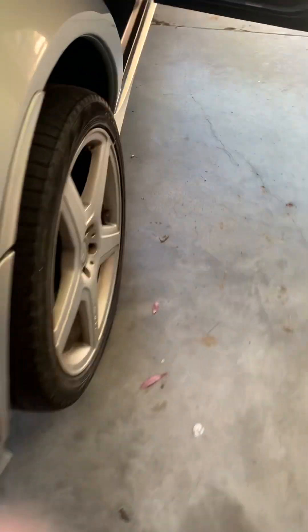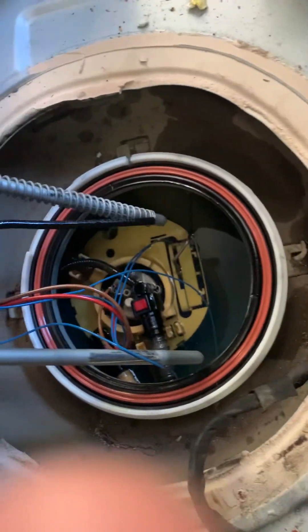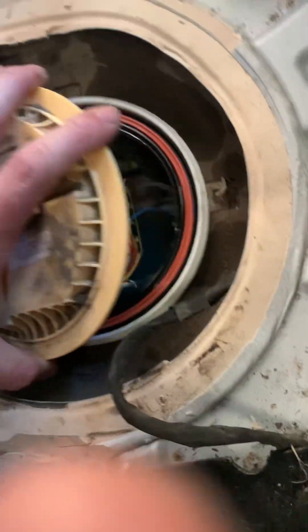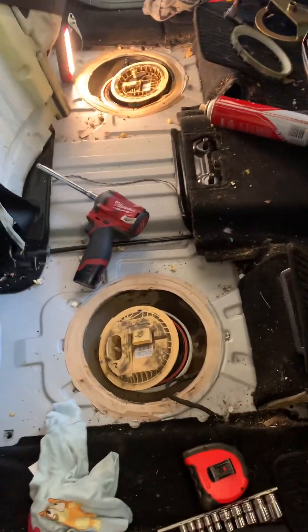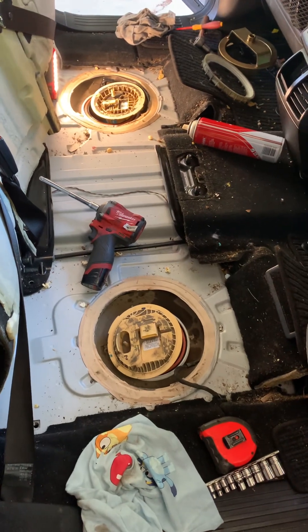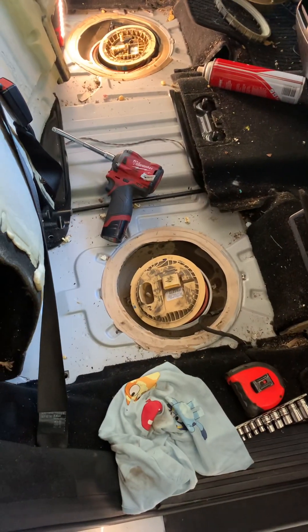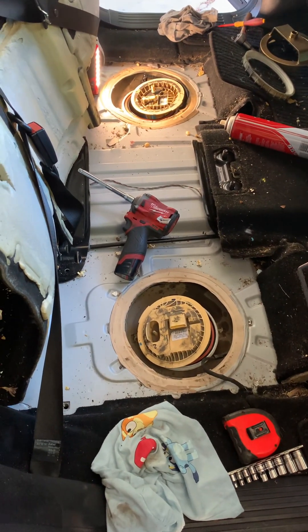Around the other side, this is our main pump with our connector — just a standard sort of unit with a heap of lines and another gauge on that side. If your car is running fine when it's got a full tank or half a tank, I strongly suggest looking at the fuel filter first, which is just under the bonnet — it's a pretty straightforward fix. Anyway, rest to go put all this back together. Thanks for watching guys.